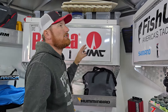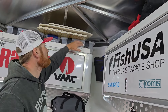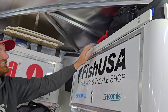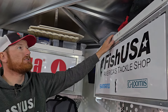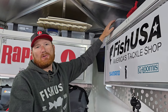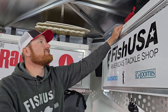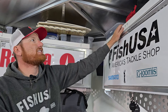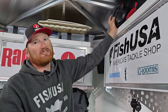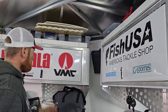Something I didn't figure out on my previous trailer was the space above the cabinets. So we spaced these out to get some utility boxes up here. I simply put a piece of angle iron and used extra strips from the floor kick plate, riveted those in so nothing can come out going down the road. We've got extra hats, gloves, everything labeled up. Labeling is good — it's not just OCD. We've got all our Dakota Lithium chargers, extra batteries, and an extra jump charger in case something happens with one of the vehicle batteries.